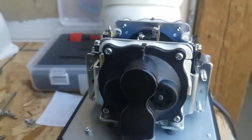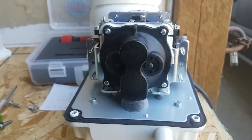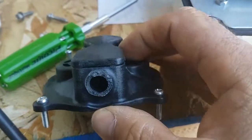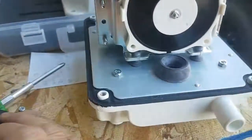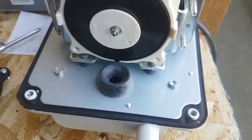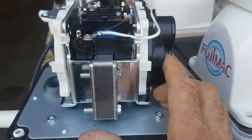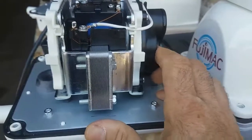I'm going to take that chamber block end off. Sure enough, as you can see, the neck is broken right off. The neck extends down into this rubber boot into the base of the pump. The reason that happens is that in order to minimize vibration and noise, these are on a very flexible rubber mounting and they move a lot.